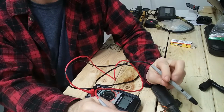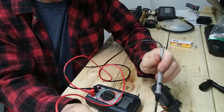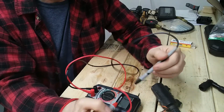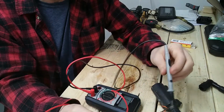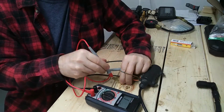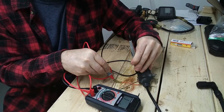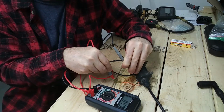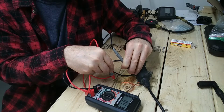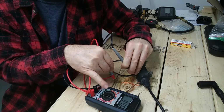So technically it's out of spec, but like I say, the range is so small in ohms on the meter, I wouldn't trust the meter itself and the connections that you're getting as being 100% accurate. So to me, that doesn't say the coil's bad. When you're measuring at this low ohms, you've got to make sure the numbers are stabilized. So what you do is get in the best physical position to make contact. Like in this case, just ramming this in here and pushing it against the table is good, and then like I said, there's a spot here I can measure against and really get good physical contact. And I'd keep pushing and moving around so you know there's good continuity, good contact. The best I've been able to do is 4.6 on this one. I think it's reading 4.6 right now, and stabilized. It's not ranging up and down.